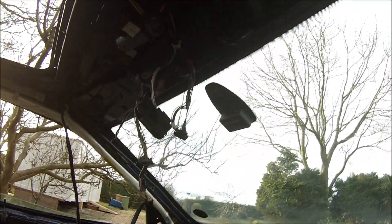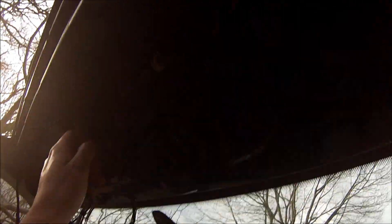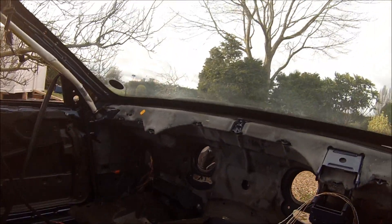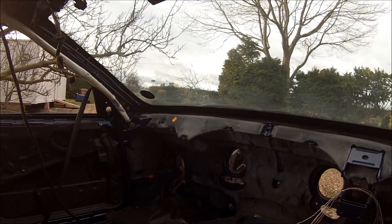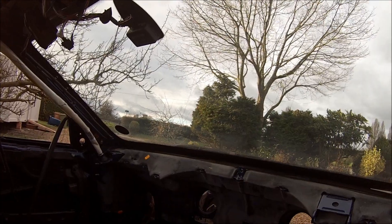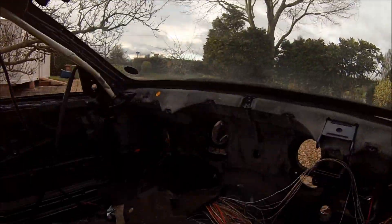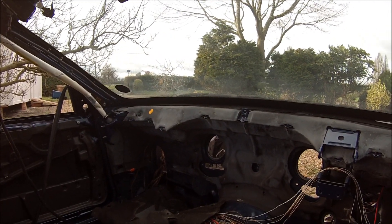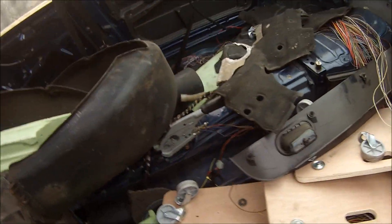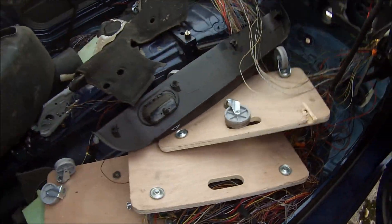This loom is scrap. The only things I'm going to have to take out of it are stuff for the sunroof and the sunroof wiring, which I think goes to the GM5 module - or just the body module - the white one that should all work. I'll just have the wires go in there. I think it's obviously had a rain sensor on the windscreen as well, so I might take that with it for auto wipers. I'm going to sort of dissect this loom for what I haven't got on the other car, move it over, then swap the whole loom over, and then I can start doing the wiring for the S85 stuff. It's been hacked up to get all the wiring out, I think for the heated seats as well.